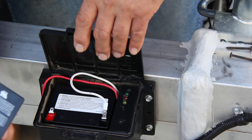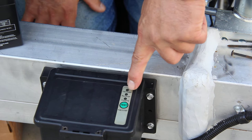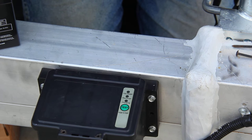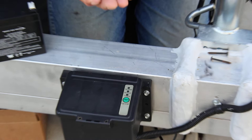Let me put these wires back in so I don't leave them unplugged since I need to use the trailer. Also, just because you test this and it shows fully charged, or you put a voltmeter on and confirm proper connections, that still doesn't mean that when you pull the pin it's actually going to stop your tire. You may have a loose connection somewhere going back to your wheel or axle. So put the tires off the ground, spin them, pull the pin, and make sure they actually stop.